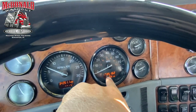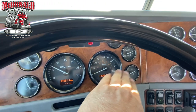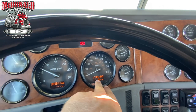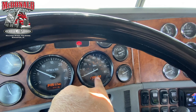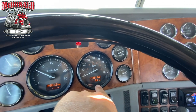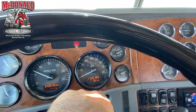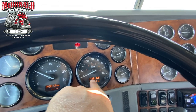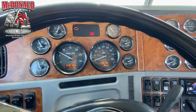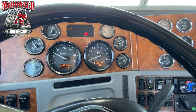The miles shown on the chassis are not the actual miles on this truck. We took a C13 out and put in a C15, and since it's computerized, the miles come off the ECM on the motor — so that's the total miles on the motor. But this truck has 300,000 on the overhaul. The chassis itself had, I think, 860,000 miles when we brought it in.